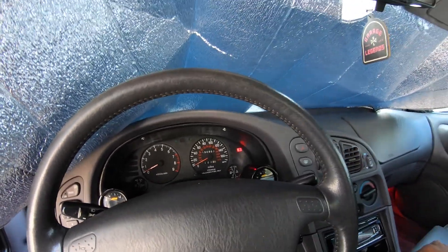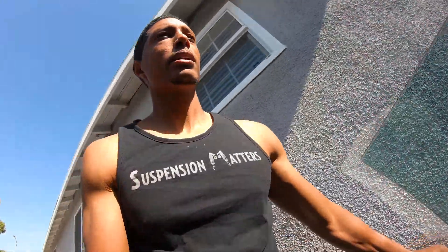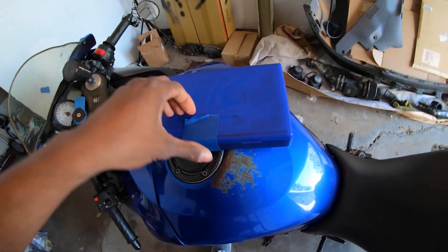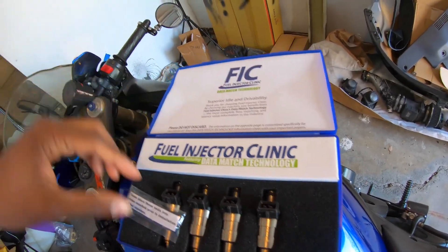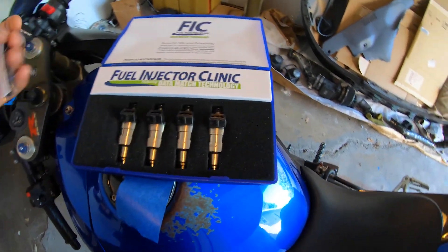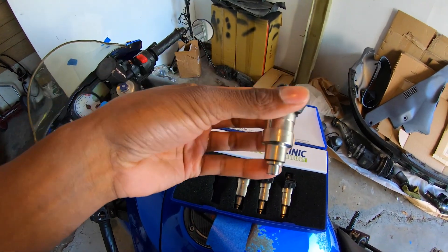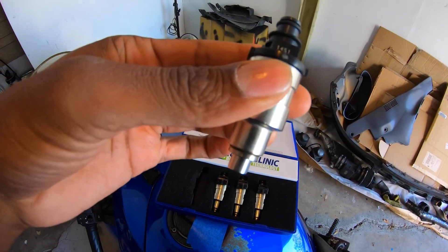I went into the ECM Link software and got on the phone with the tuner — he told me all the parameters to set so it reads efficiently and correctly. Now the last thing to put in is the fuel injectors. Pretty simple: disconnect the battery, have some towels for when fuel spills. These are FIC injectors but they're low-Z, not high-Z. The tuner said high-Z are the way to go — these aren't as consistent or efficient, it's older technology — but we're putting them in because I already bought them.